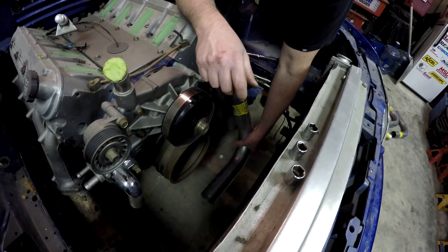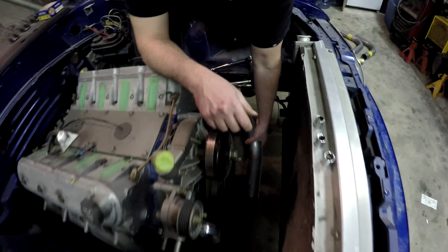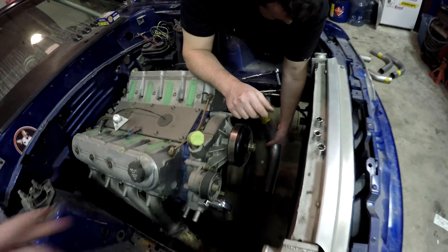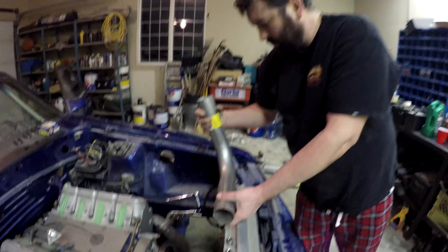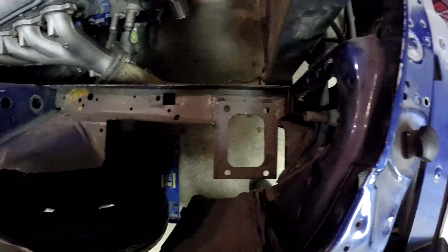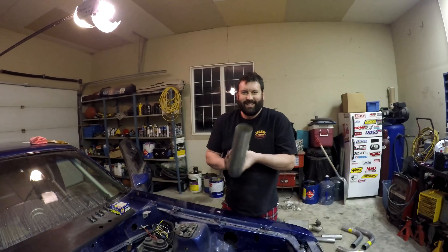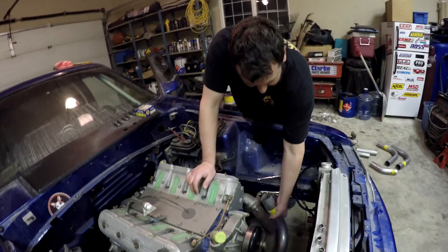We're discussing how we're going to start this off. The first step is taking that flange back off and cutting it how we want it — just right after the O2 sensor. I think we should cut it at a bit of an angle to pull it out. My plan was that it would come in line with the circle flange and then just be a 90. Are we doing pie cuts everywhere? Yeah, we can make it as ugly as we want — well, pie cuts aren't ugly, depending on how sloppy the welds are.